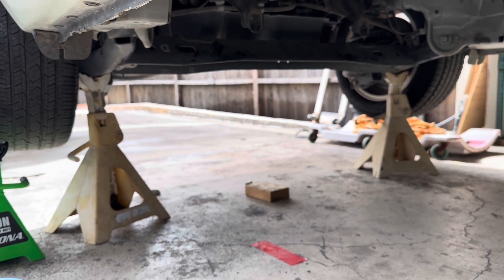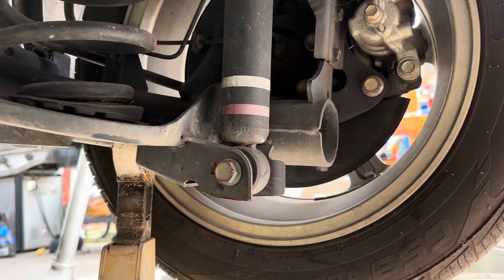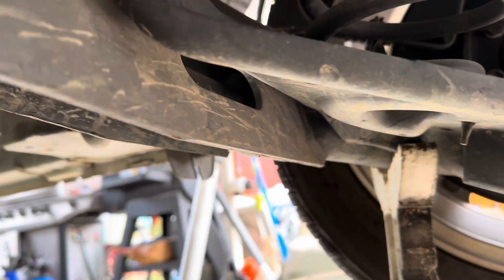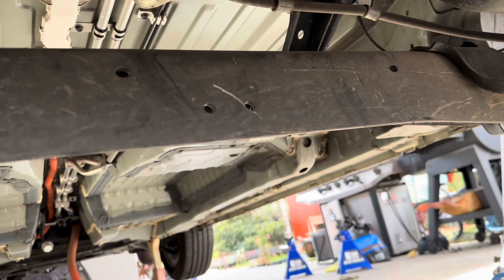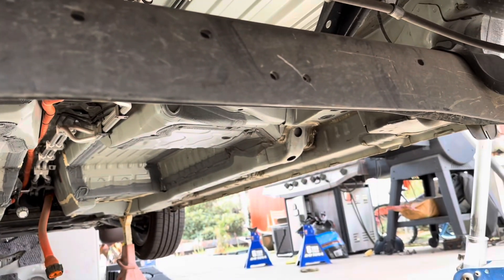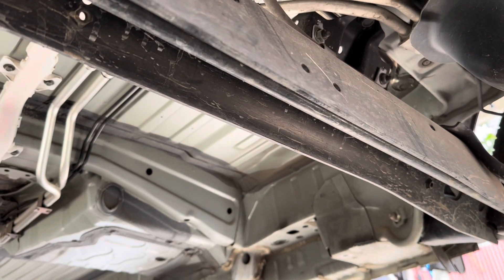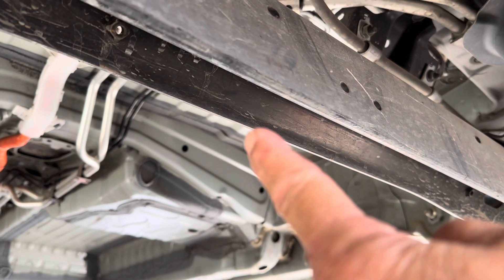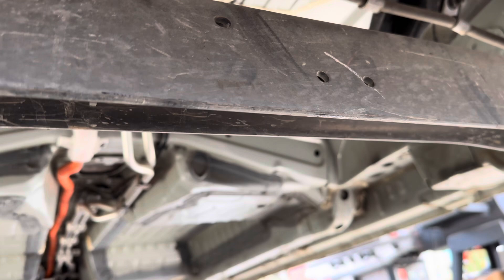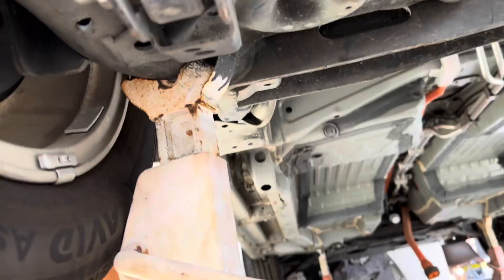I now have the car on the rear crossmember — it's actually the rear swingarm of the suspension — which gives me a very sturdy, thick place. I believe I could put my floor jack under this, but it's uneven, so I would put a 2x4 in here and hopefully be able to jack up the entire rear end in one jacking. That'll save me time.